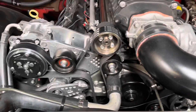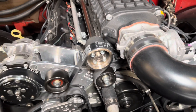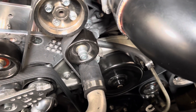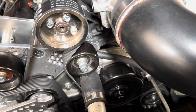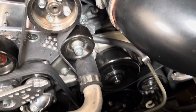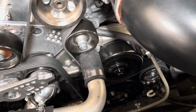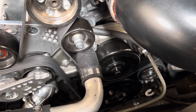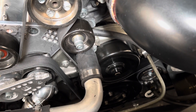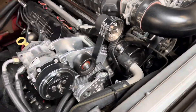To solve the problem, I simply put the pulley back where it belongs — right where it was supposed to be. Sorry Dirty Dingo, I don't know what I was thinking trying to outsmart you guys. Either way, it is now together running an eight-rib setup. The ATI balancer — I keyway-pinned it, put it back on with some Loctite. There was some crankshaft damage but that was actually there before when I first got the motor — the pulley was loose and spun a little.